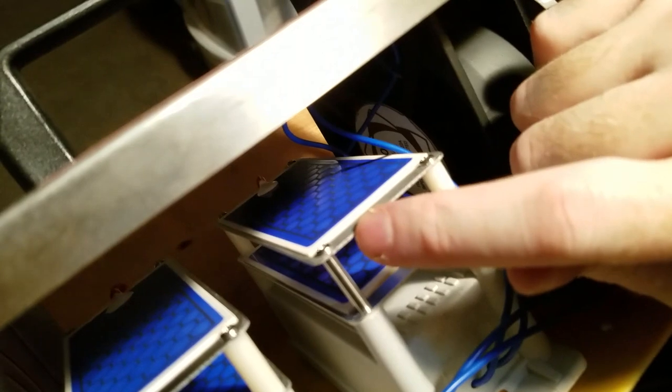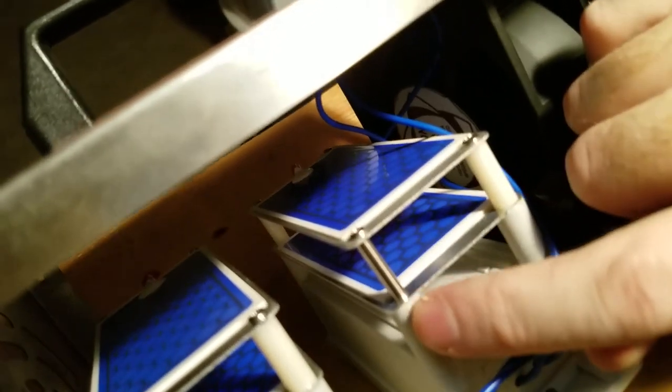there's a red wire on this side, which is connected with a washer electrical connector back there to the bottom plate here. And then the electricity on the other side is connected to the top plate, so it's connected to this metal grid that's inside this blue plate here. So then you get a corona discharge between the steel plate and the blue plate. And that's connected to the metal plate right here by this metal rod, which has a screw in the middle of it. The screw goes down into this gray body here. So that's the electrical connection right there.